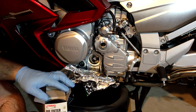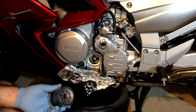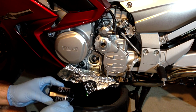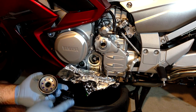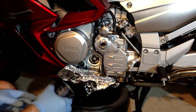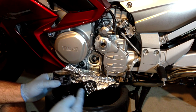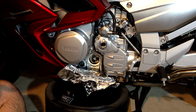Got the oil finally petering out of the filter. Now we can go ahead and put on our new one. Of course, properly dispose of all your materials. With the new filter, the only two important things are: don't get the surface dirty — the OEM filters have a nice plastic protective wrap — and lightly coat the rubber ring with new oil before you put it on. You only hand tighten these. You never use a tool when installing a new oil filter.